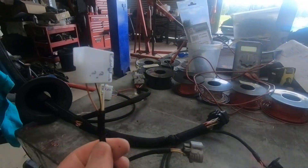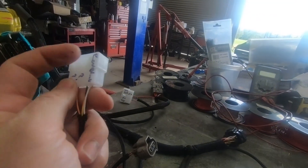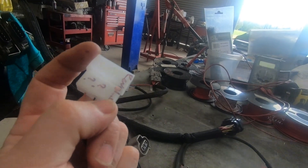We can make that speedo bang on by calibrating with the ECU without putting extra boxes in, so we're utilizing the ECU to its full potential. I've used almost all the plugs and terminals - there's one I didn't use; I could have put an oxygen sensor on that one but I prefer to put a wideband in. I've also got the reverse light wiring - I don't know where the reverse lights are in this vehicle at present, so I put a plug on the loom. If it isn't used it can just be taped up; if it is used it comes up to that plug.